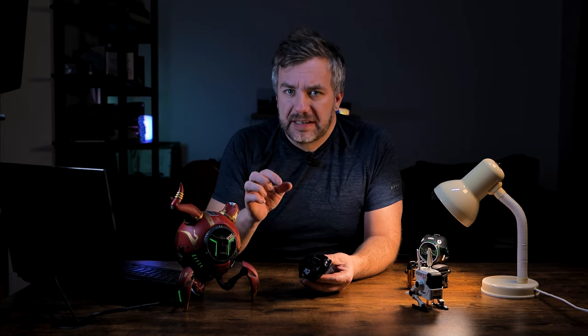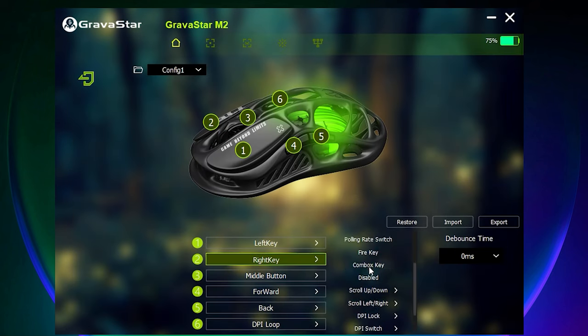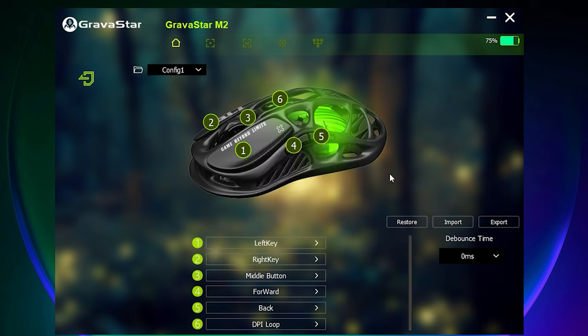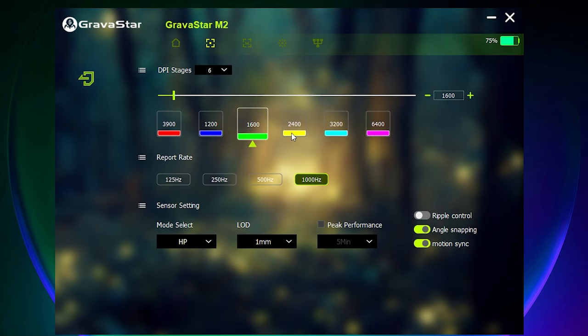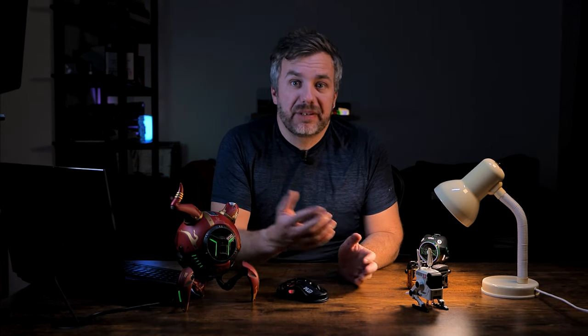Before you get excited, there are a couple of things missing. First, the device can only be paired with a single Bluetooth device, so if you want to hop between computers there's no option to pair multiple devices. Also, you cannot configure the mouse via Bluetooth — you have to have it connected via dongle to use the utility to configure buttons and lighting. In Bluetooth mode it will act as just a default HID device. On the dongle side, while you can configure profiles, build macros, assign button functions, and control debounce on the buttons, you cannot store different profiles on the mouse itself. You'd have to export files and set them up on a new computer.